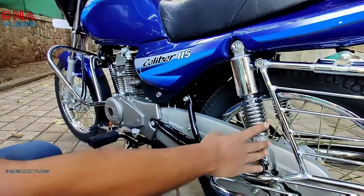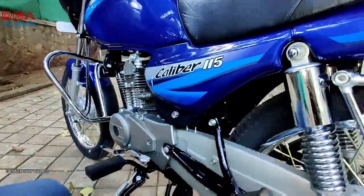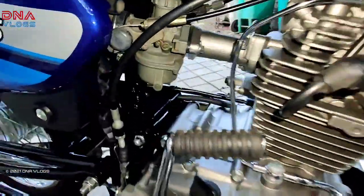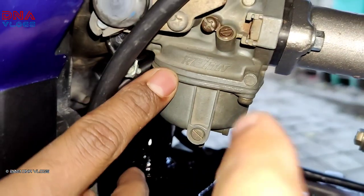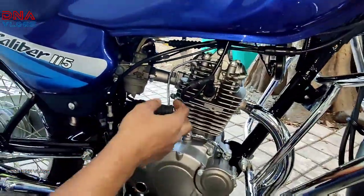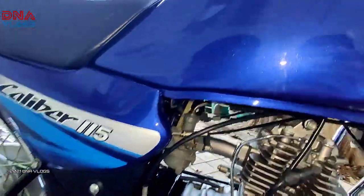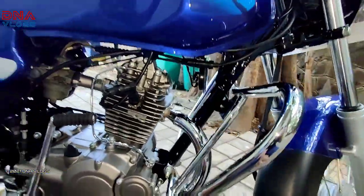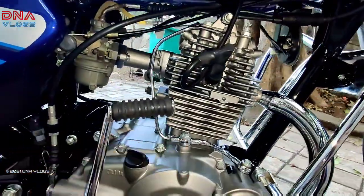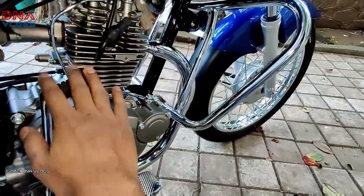The parts are original. The front suspension used to come from Endurance. It used to have a Keihin carburetor, which Kawasaki still uses in its sports bikes — you can see the branding right here. The bike is based on KTEC technology, which was a patent at that time. Oil capacity is 1 litre. It's an 111cc 9bhp single cylinder air-cooled engine. My dad used to get around 75 kmpl, and since it's sort of in a run-in period now, you can expect a mileage of around 70 to 75 kmpl.